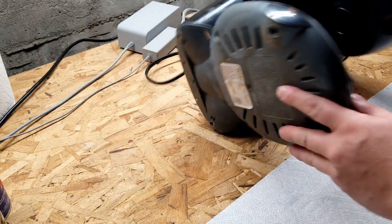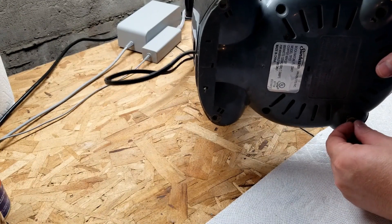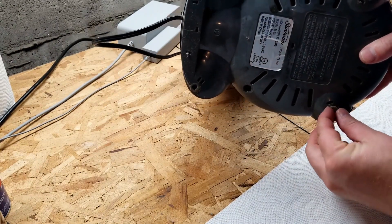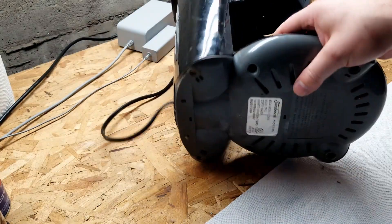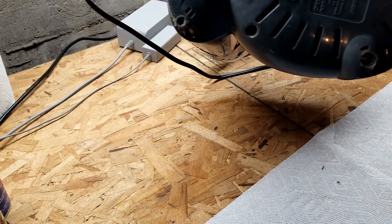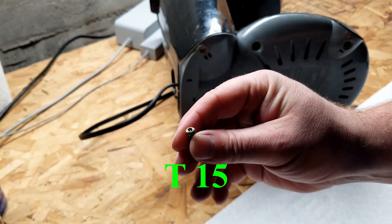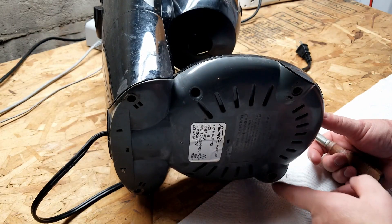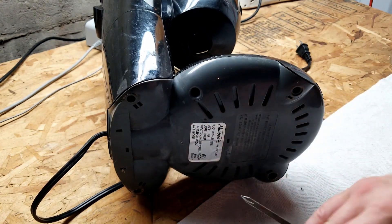Mongo's curiosity says: what killed the coffee pot and can Mongo fix it? Under here usually there's these little feet things - they pull out and there's usually screws under there. Those two aren't there. They've got torx bits down there - the safety torx - just these two front ones are the safety torx bit. The middle two and the rear two are standard Phillips.